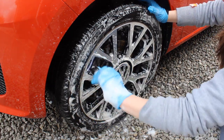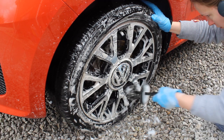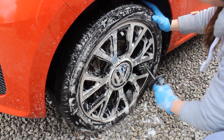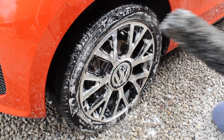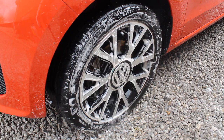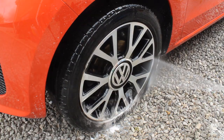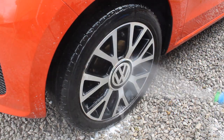Once I'd cleaned the alloy face, I moved on to the barrel using the SGCB UK barrel brushes — the microfiber style, which are really gentle. Delicate finishes tend to cope better with these than bristle-style brushes. With the gloss black elements on the wheel, using a combination of Garage Therapy Wheel Shampoo for good lubrication and these soft brushes got them to a really good level of clean whilst being quite safe on the finish.